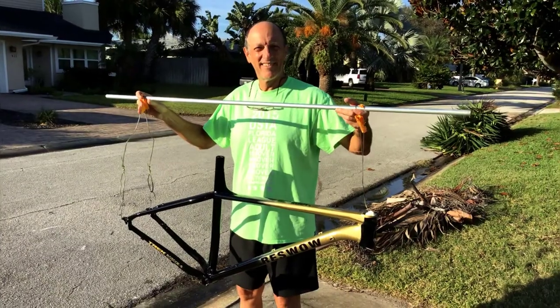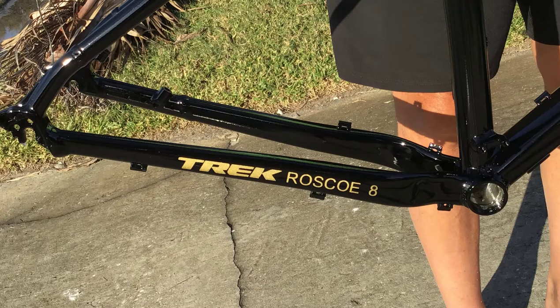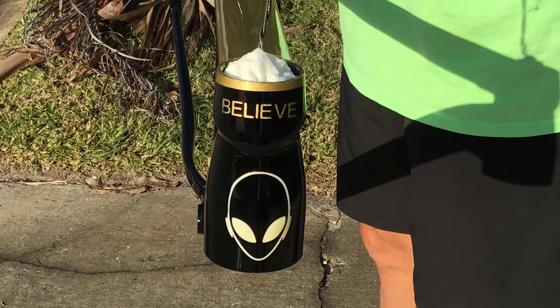The paint job came out great. Let me cover some lessons learned. Frame prep: the paint stripping process is absolutely awful — the chemical stripper works fair, it's a lot of sanding. Don't try to knock it out in one day because your hands are going to be shot from pressing with the sandpaper, and you're going to be frustrated. It's very long and tedious. If you can spread it out over a week — maybe one big day on the weekend and one or two hours a night for three or four nights — you'll knock it out with good results.